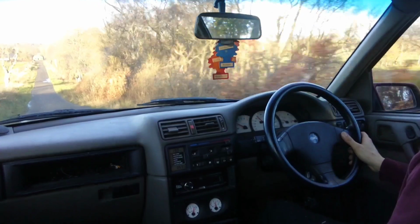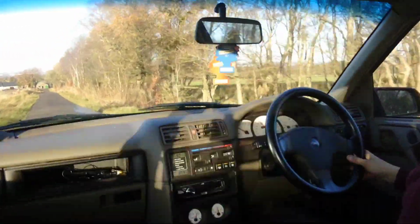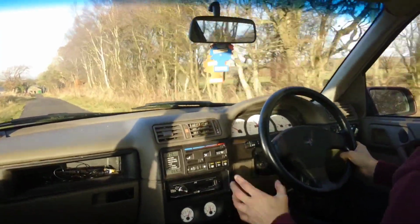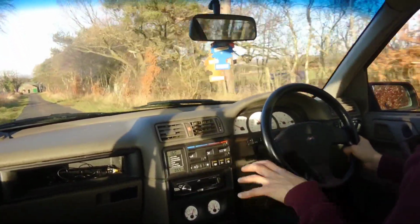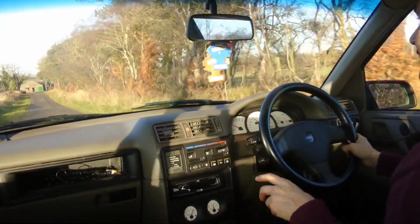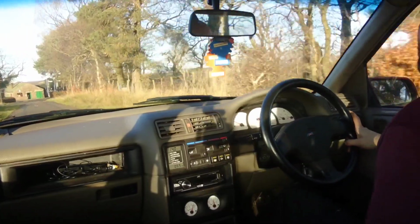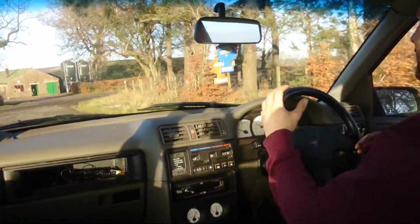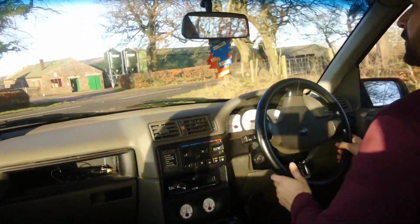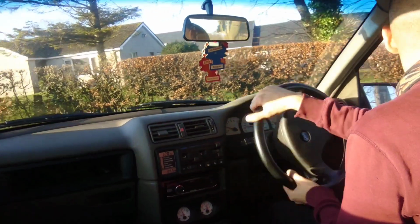Now, what's been done on the car is it runs a Cavalier 2.5 V6 C25 XE manifold and sump and engine management setup, and underneath that is the 3-litre X30 XE engine from an Omega police car. The engines are basically identical externally, so you can swap everything over, which gives you an immediate 40 horsepower uplift. You get from 210 from 170.